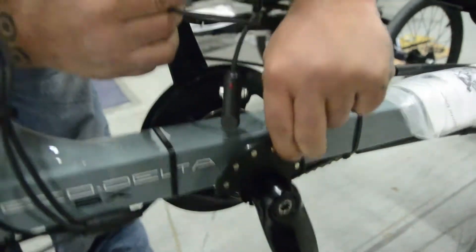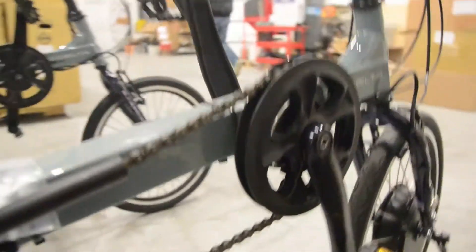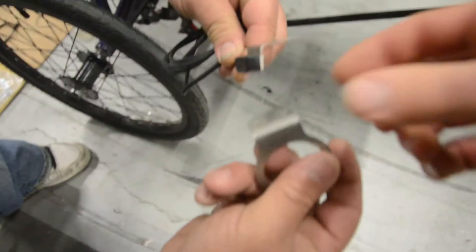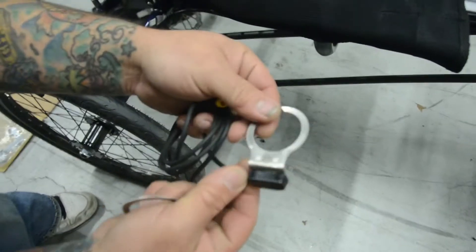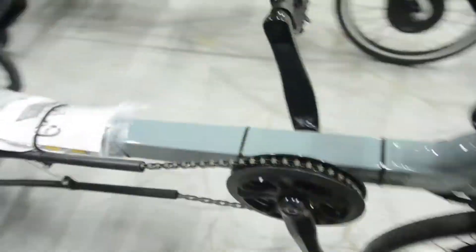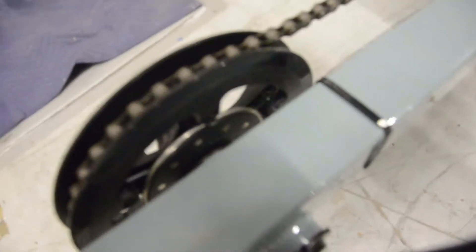Instead of that, when doing it in the shop, we choose to mount a ring-type pedal assist sensor down under the bottom bracket. This means drilling and tapping a hole into the bottom bracket for direct mounting. The bracket we use is a right-angle ring-type bracket — a modified version of our regular TDH sensor ring bracket with a 90-degree bend — so we can mount it directly to the frame and adjust it left and right to get everything lined up, since the bottom bracket spindle length doesn't give enough room to mount inside the right-hand bottom bracket cup.